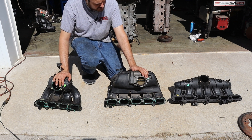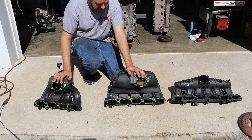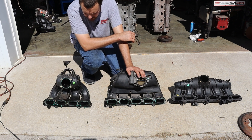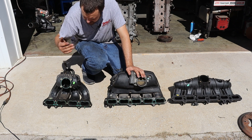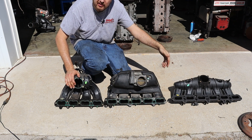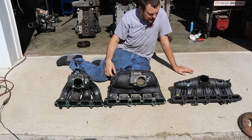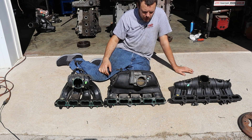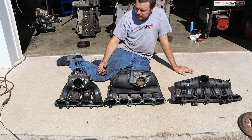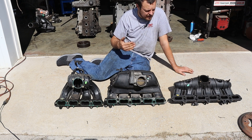Starting at the top, you'll notice that all of the engines feature this glass fiber reinforced nylon intake manifold that wraps over the top of the engine. The intake flanges on all three units are very similar, but the 5-cylinder lost a cylinder, and the 4-cylinder lost another — it's the same exact pattern, just with part of the flange lopped off. We've taken a 6-cylinder to 40 pounds of boost with a stock plastic manifold, so it's a pretty capable platform. They all have a fairly long runner, so they're definitely better for making torque than horsepower, but for performance guys, they're not a bad option.